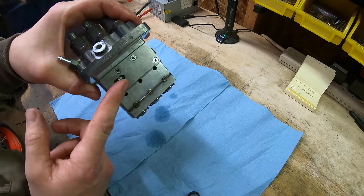Before disassembly, each delivery tube and its corresponding barrel are marked with a paint marker. If the delivery tubes are not returned to exactly their factory position, it can affect timing. Each tube gets a mark, and the slotted barrels beneath also get marks since those are additional adjustment points for timing. Everything must go back exactly where Kubota set it.